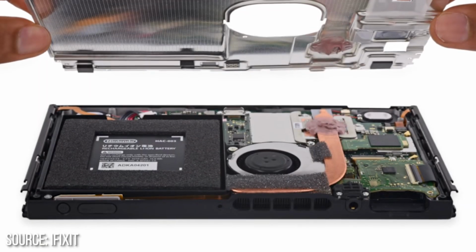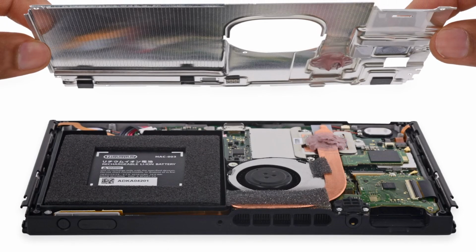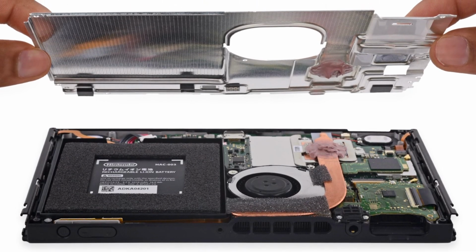Using my compromise switch, I was also able to measure the temperature of the processor using its internal sensors. Before we look at the data, it is worth stating categorically that the switch fans spin up considerably more when overclocking, so any increase in temperature we're going to record here is happening despite the more active cooling, the louder fan. Okay, stock measurements first.